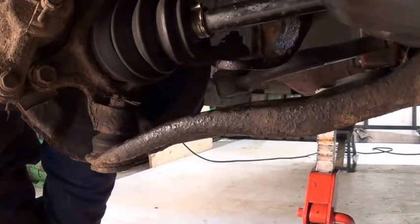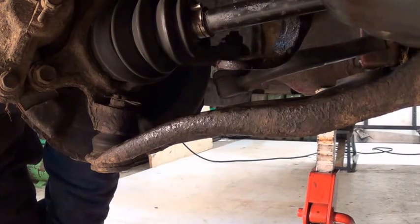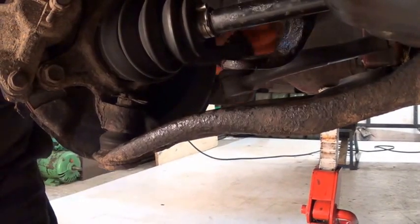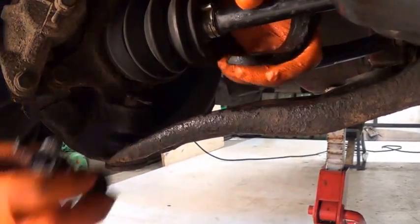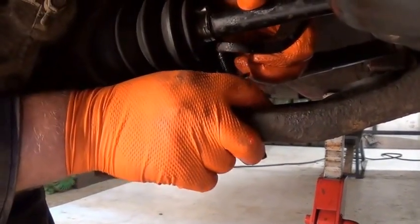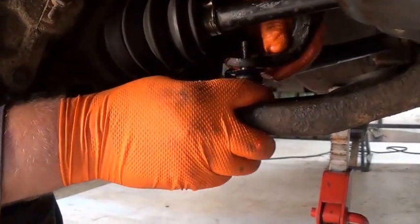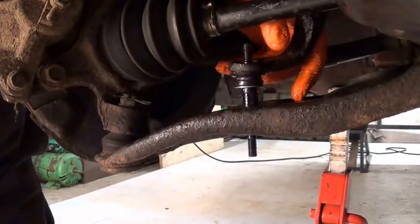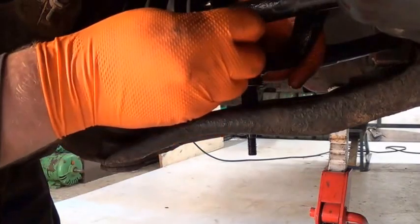Bodywork to anti-roll bar mounting bushes and brackets are in place, and they're all finger tight. I've also put the link arm in on the passenger side of the car, so I'm just going to drop the driver's side one in. A bit more fiddly because of everything else being in place, so that drops in there. I've put a bit of red grease on this as well.